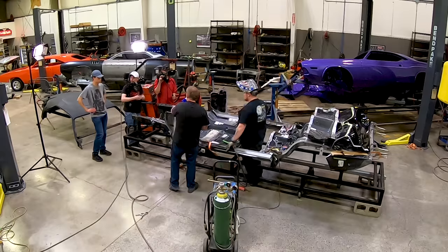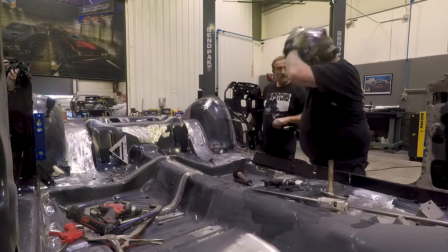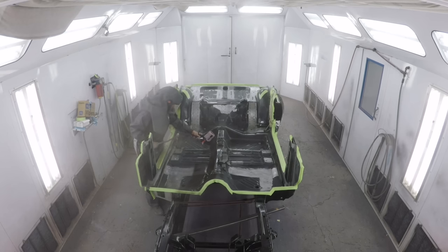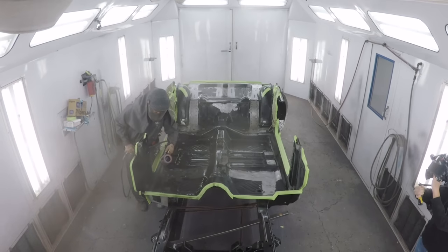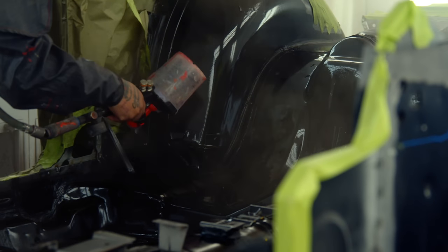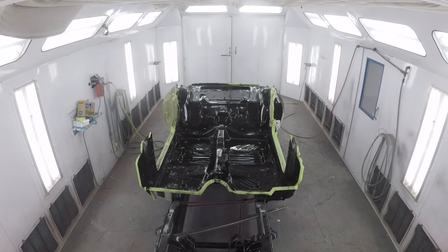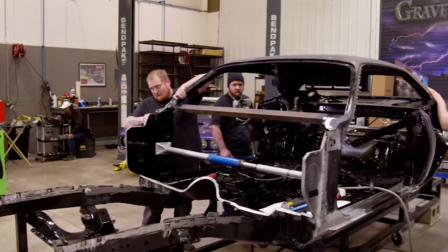With the foundation built, the next thing was to put on the B-pillars — a part of the car that has to be in its established place. From there, we did the inner and outer wheelhouses, the rear crossmember with its extensions. When we were finished with the floors and lower stuff and began with the wheelhouses and pillars, Will came by and said, 'Why don't I paint everything now?' That was actually a great idea. It's black, so it's just a 9300 single stage — super easy. That way, every square inch of the car gets painted before outer structure goes on.